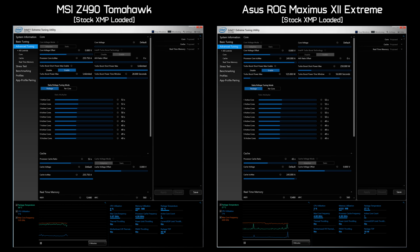Now, here's a look at the total system power consumption numbers, and as you can see, when adhering to the 125-watt TDP spec, the 10900K sips power, as total system usage is just below that of the Ryzen 7 2700X. So that's a pretty good result, really. I should note, though, that this is the sustained power usage once the processor backs all the cores down to 4.3 GHz. Prior to that, power consumption looks very much like what we see with MCE enabled.